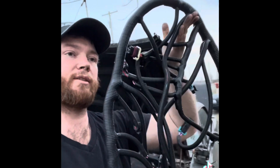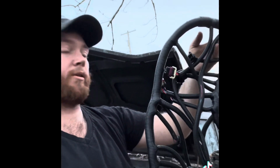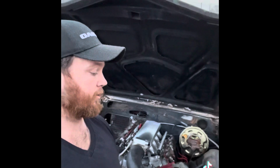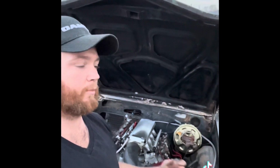So with your $100 Amazon harness, you got the harness, you got some shitty instructions, and you got some injector adapters that go from EV1 to Multec. This harness specifically is for an LS1 4L60 combination. In the past, people have been worried that they got the wrong harness because this has a 4L60 plug on it, and they're running something like I am with a Turbo 400. So just because your harness has a 4L60 or 4L80 plug on it doesn't mean it's the wrong harness.